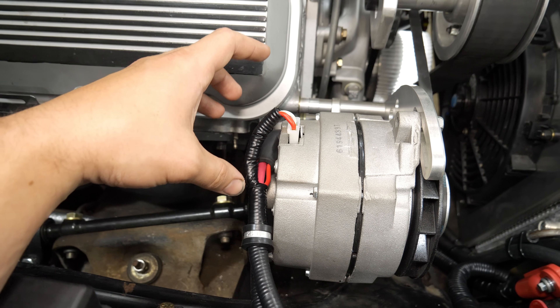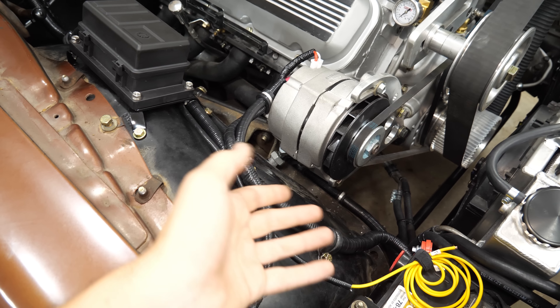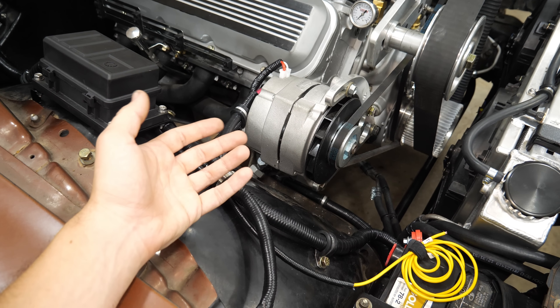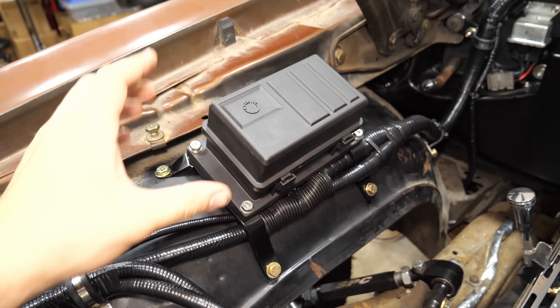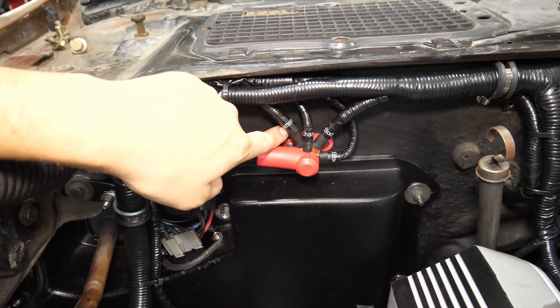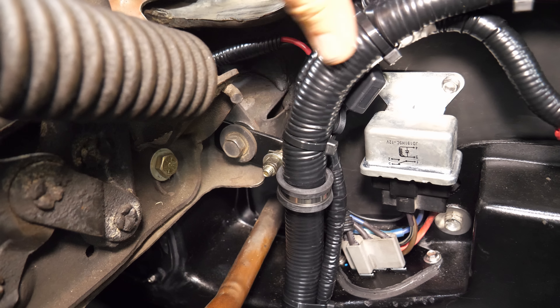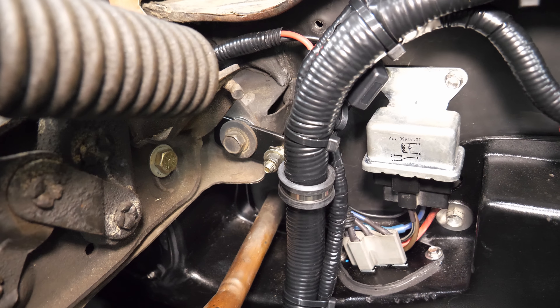I did the kind of redneck thing and wired a three-wire alternator as a two by connecting the voltage sense directly to the output stud. Essentially that wire is meant to sense an accurate voltage, and when it's remote-mounted in this car the best spot would probably be out at the junction stud. There can be some voltage drop over the wires and that gives it a more useful voltage reading, so it'll put up a little bit more power a little bit sooner. But really there's not a huge load on this car — all the other wires feeding everything are pretty big and not all that long, so there shouldn't be a huge amount of voltage drop. Mounted to the inner fender here is our fuse and relay block. There's a main feed wire that passes underneath and comes all the way up to the junction block.